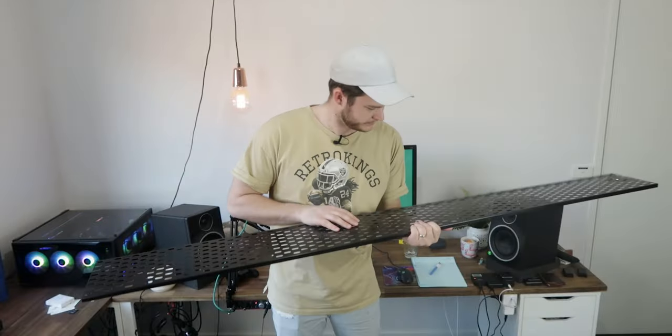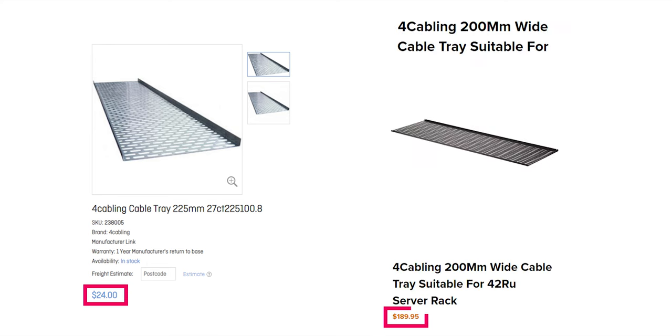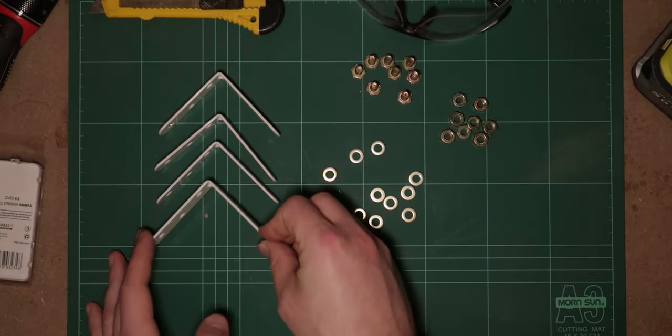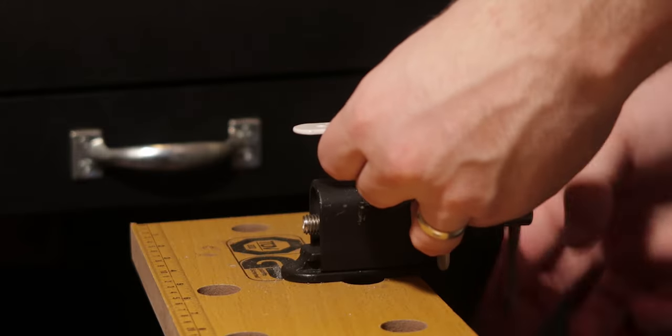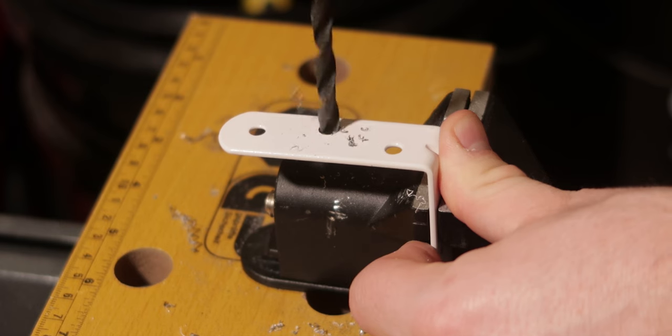To get started, you need to buy some Rack Server Cable Tray. This stuff can run you about 20 bucks if you find the right place, so shop around — don't pay 150 bucks, you can get it cheaper. Then I popped into my local hardware store and grabbed a couple of right angle brackets, bolts, nuts, and washers. Everything is in the description below. Since we are doing DIY, don't be afraid to grab right angle brackets that don't fit perfectly. Here I'm just upsizing them to quarter inch to fit the bolts.